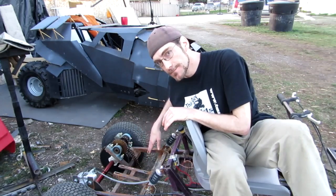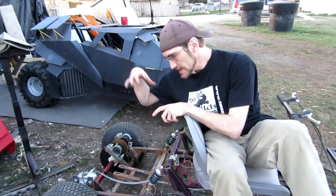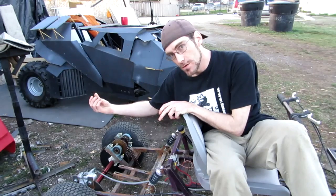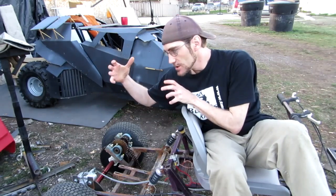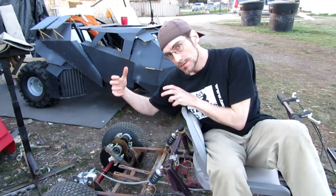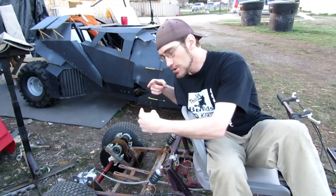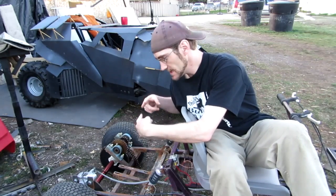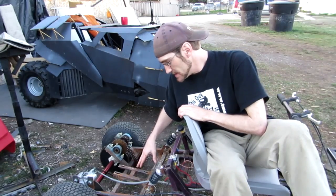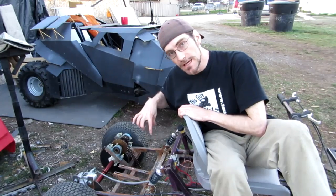If you have a setup where you have a plate with your engine on it and a single bar running straight down, that's bad — once the engine starts to deliver power it will tilt because the steel has flex to it. You're going to want to put cross bracing in there going side to side like a big plus symbol. Or if you have a setup with two bars and your bolts go into the engine, then you really don't have to worry about it.